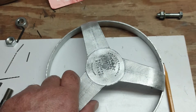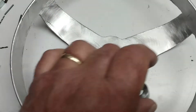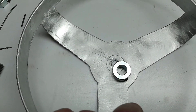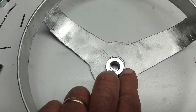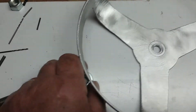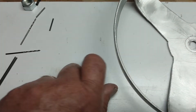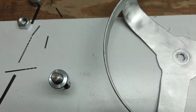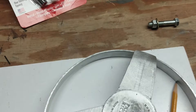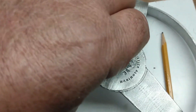In order to drill straight through the steering column into the bushing, I've made a little line on the outside on the front of the steering column. Then I'm going to install the bushing into the steering column with a little stud I have laying around — it's an old exhaust stud — so this way it will align it perfectly once I get it started.